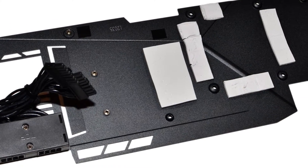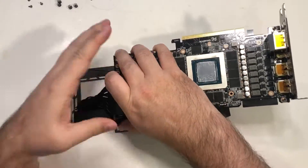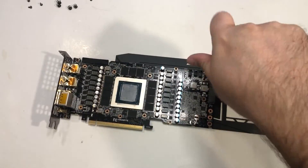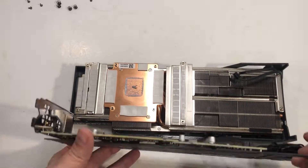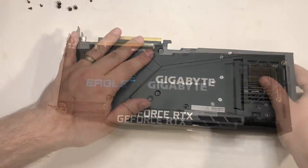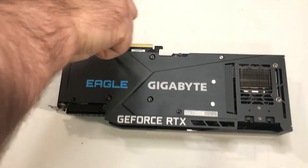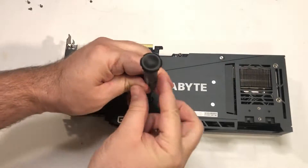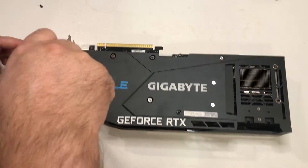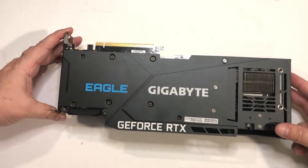Not much else to say here — you can see the backplate. I'm just going to zip through and put it all back together, reversing the process: connect the power cords, put the backplate on first, and then do those three screws. Once those are back in place, flip to the main cooler and get that put on, connecting the three fan connectors. Then put all 12 screws back in. And there we go — we have the original card once more. I did do some testing and I'm happy to say the card still works fine. I put in a little extra thermal paste on the GPU before putting it back together just to make sure there was enough coverage. Temperatures don't seem to have changed.